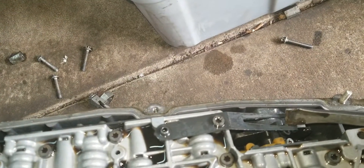I'll keep you posted on what happens when we swap the valve body. Hey guys, I'm back with the good news — I did put in that valve body into this transmission and the gears are shifting correctly now. This is the swap that we did. A couple of notes: this right here goes just like that. Make sure you unplug your harness when you remove the valve body from the transmission — make sure you unplug that harness right there.